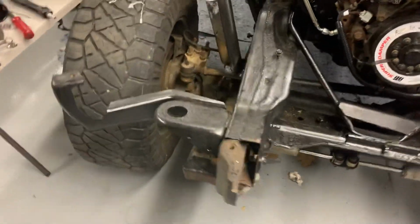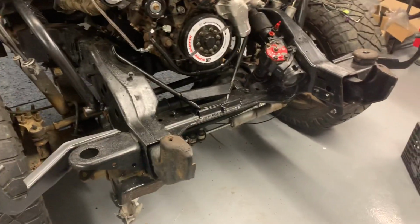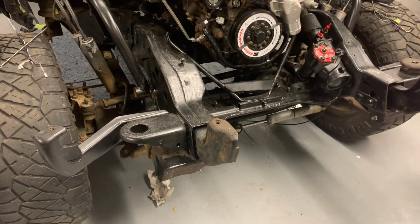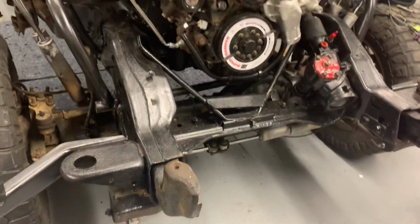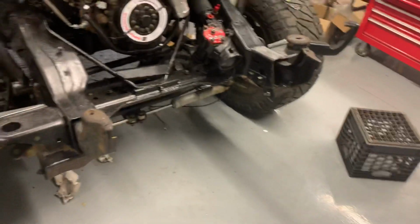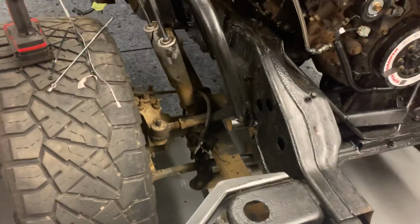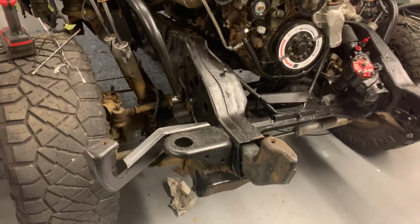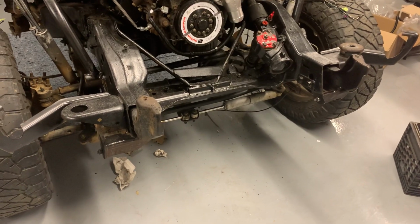So at the time, the two companies that I looked at were Off-Road Design and Sky Off-Road Manufacturing. And Sky made a kit that was a 5-inch cross member style front mount, meaning that just the mount alone netted a 5-inch lift. So that would have meant running like a stock square body spring, which are negatively arched, and I didn't want to run negatively arched springs. I wanted them to be as flat as possible. Not a suspension expert, it just seemed like a good idea, so that's what I wanted to do.